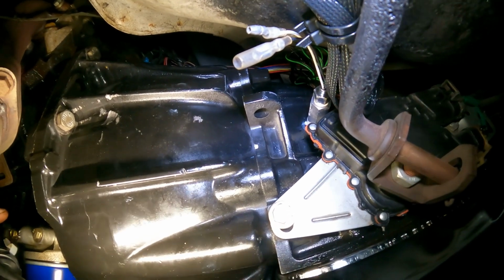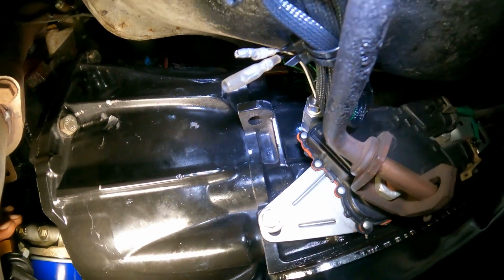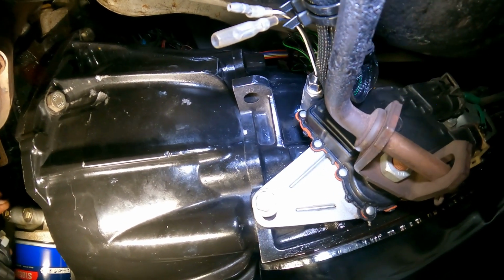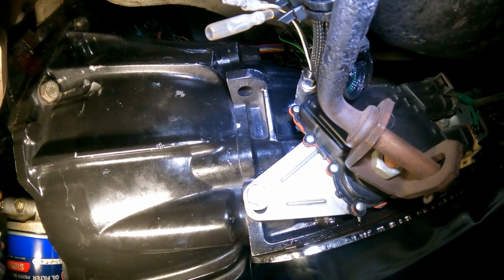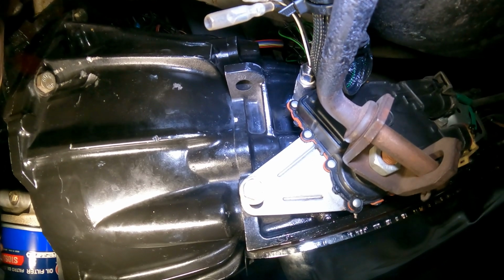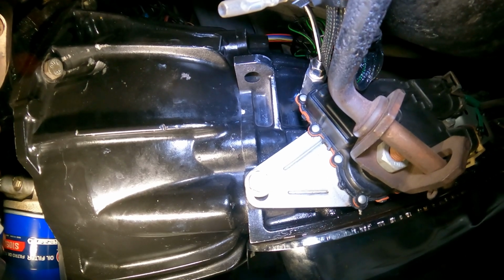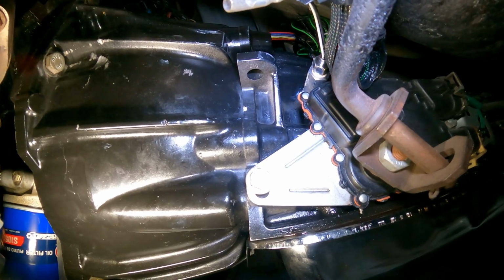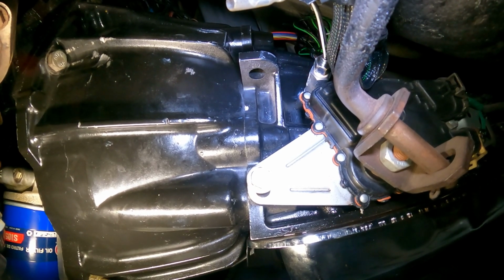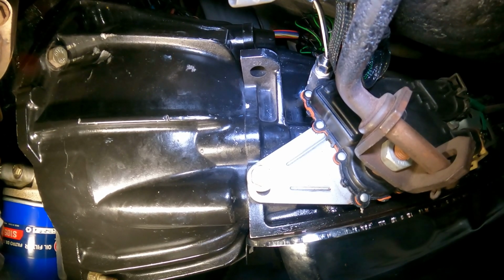So by tomorrow, I will definitely continue this video to show y'all the end result. Hopefully when I start the car, we have no fluid leaking, then we can connect the hardware, and then we do our test drive to make sure everything holds up, to see what temperature we're running, because I put the big 40K transmission cooler. The max is supposed to be like 150, and I'm not supposed to go higher than that. So that's what we really want to see, and that's what we're doing.